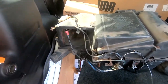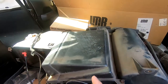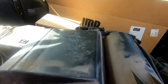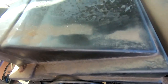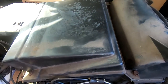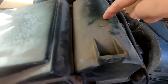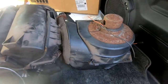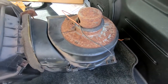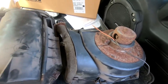So a fairly sizable unit. You got the blend doors, heater core of course sits up here on the top, which is why it's such a pain to deal with — because from about here back you can see the line, and the dust from that point rearward sits under the cowl and is next to impossible to work with. Then AC, then fan unit. This part comes separate but I just got it sitting in here for hauling to storage.